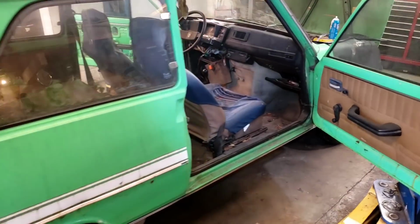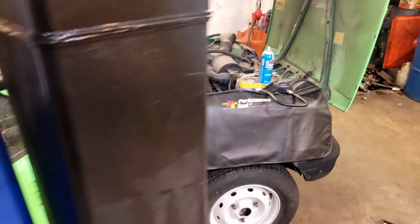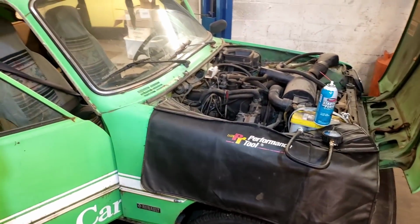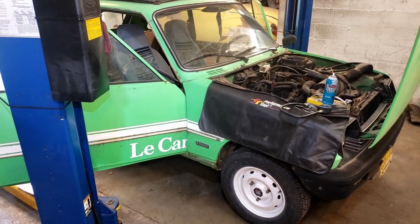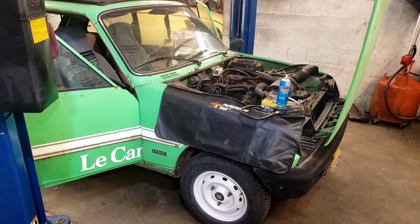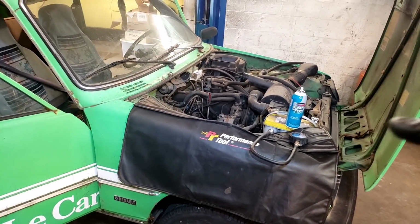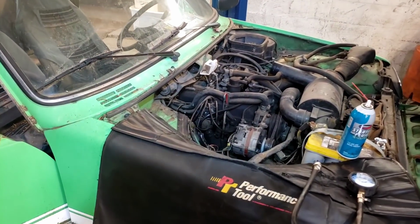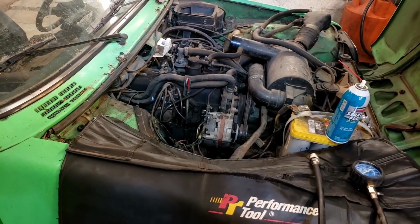and sitting around the shop for a long time. This is my pandemic catch-up experience, or trying to get stuff caught up in the shop, and probably a car realistically I wouldn't have touched for a long time. And I'm feeling really bad because I didn't realize the engine was so stuck. So we pulled out the spark plugs. We soaked the cylinders with automatic transmission fluid over the weekend. That seems to lubricate them up pretty well.